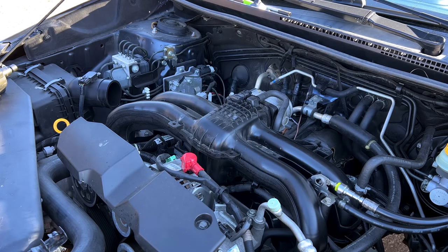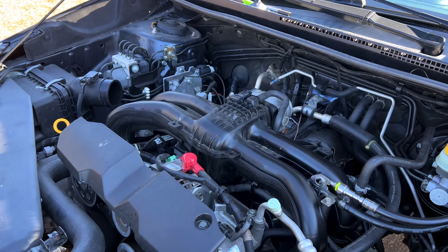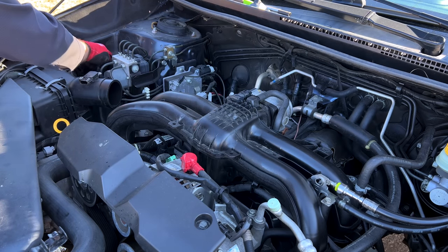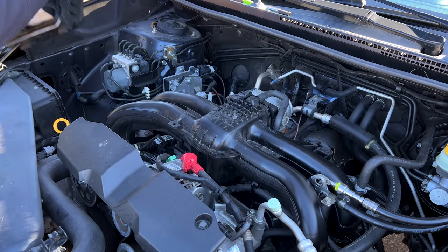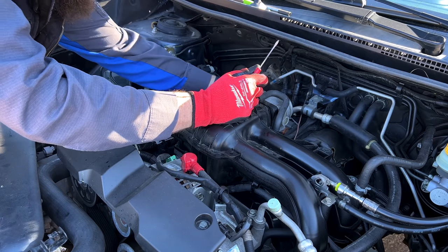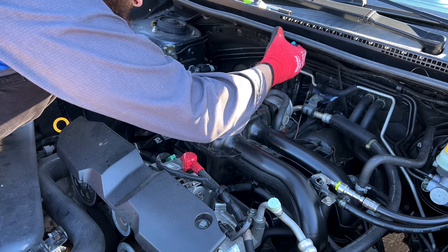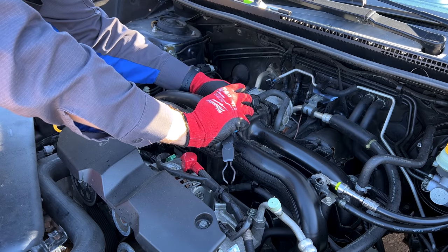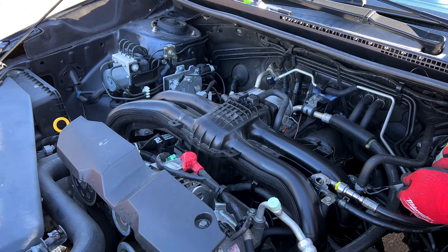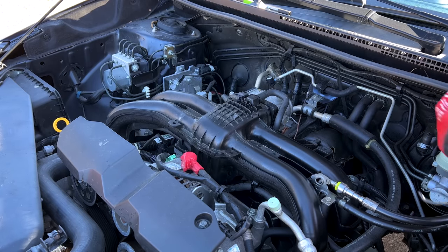Now that that is out of the way, we need to go ahead and remove part of our air box, just so we can get over to the side of the engine a little bit later when pulling this intake manifold off. I'm going to reach up here and disconnect our MAP sensor, and reach back here and disconnect the electrical pigtail on our throttle body. We need to grab our PCV hose where it goes into the intake and slide that off. Over on this side we need to take loose our brake booster vacuum hose from the intake manifold and set that to the side.